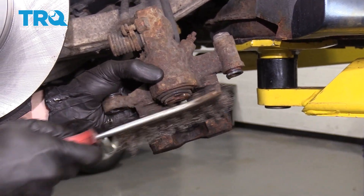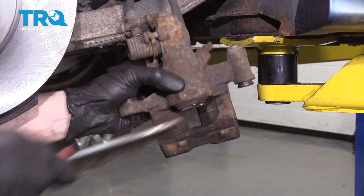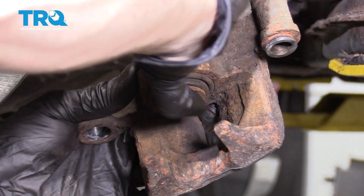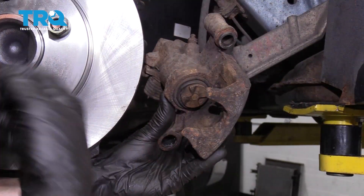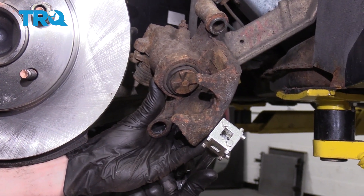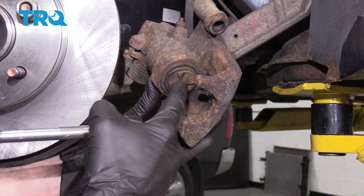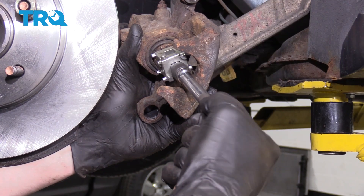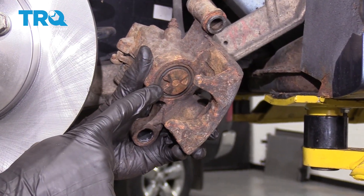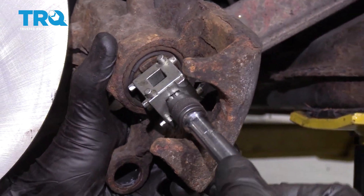In the spirit of cleaning, let's continue with that wire brush and clean up this entire area in between here — this is where the rotor and brake pads are going to be, so make sure it's clean and free of any debris that might fall into the brakes. Now let's continue by pushing in this caliper piston. Typically you can use some sort of clamp and press it right in, and the piston should go into its resting position. On this particular caliper, looking at the piston you'll see two little dimples — you're going to need a special tool that fits into those dimples so you can twist the piston as you press it in. If you don't have this tool, you could try using long nose pliers, though that's a little harder. When finished, you want these dimples facing essentially straight up and down.